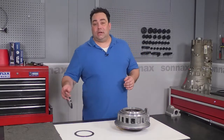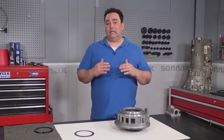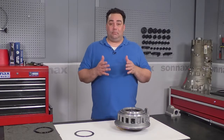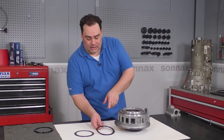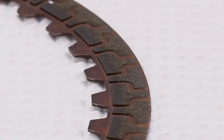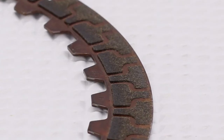When a backing plate isn't strong enough to keep the clutches flat, they can't apply evenly and completely, and this leads them to actually cone out when they apply. This leads to uneven wear and big time burning. You can see the uneven wear issue here on this clutch disc — only the outer portions are actually worn. This means all the shift energy is going through a very small portion of the clutch disc, and it's not designed for that.